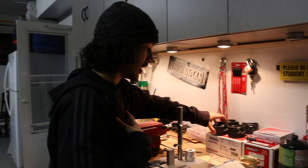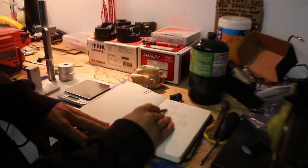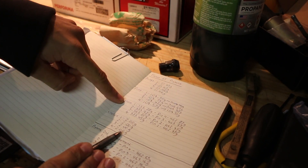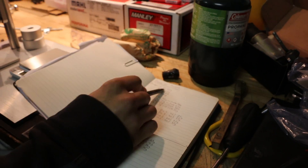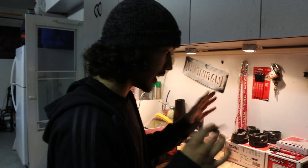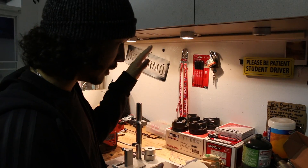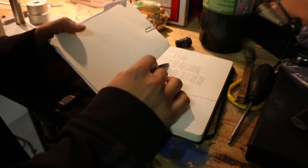Previously when I got all the components I did a first measurement of literally everything — rings, pin measurements, piston measurements, and the circlips. They all measured out the same. Rings are already gapped and dedicated to their cylinders, so that's done. This is a little weird — I'm not sure why there was a change in measurements between then and now.